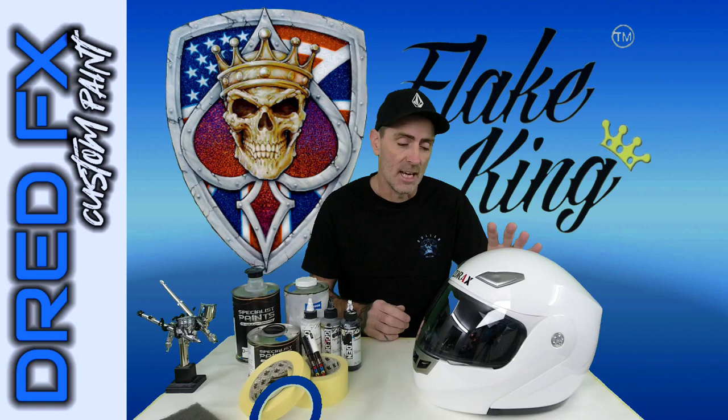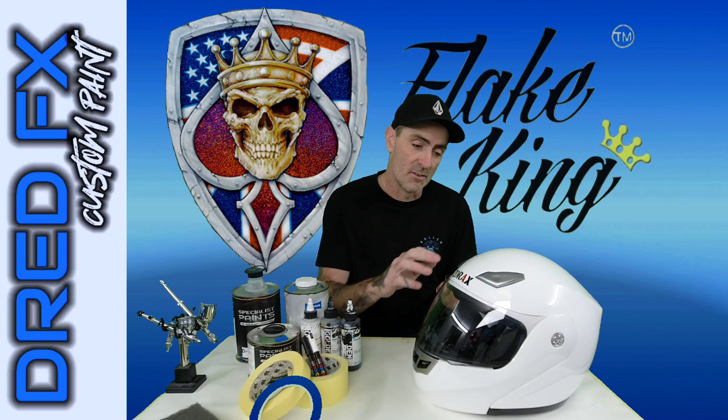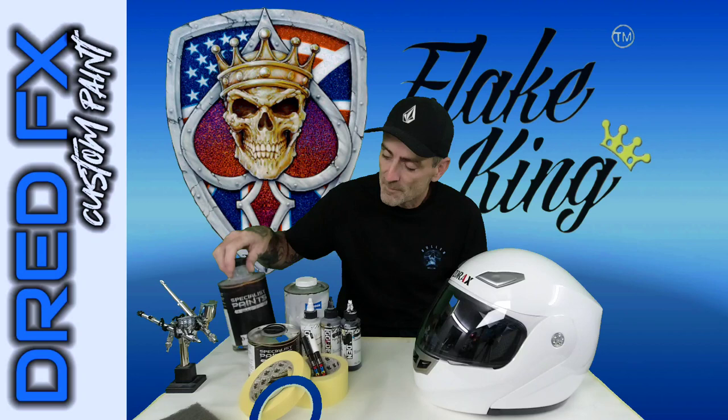We're going to go in with some solvent base coats on this, so we've got a silver base coat which will be the main colour. We've got some plastic primers if we need them to go over some of these small intricate plastic pieces that need to be painted over. We've got some specialist paints. We've got the Candy Fool's Gold, so there'll be a bit of candy paint in this.